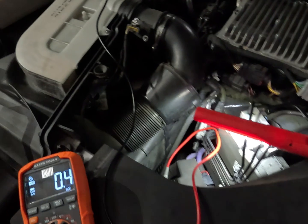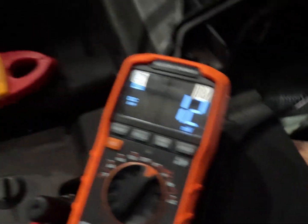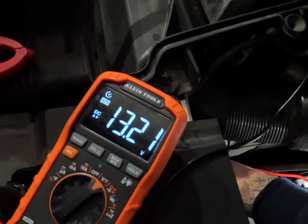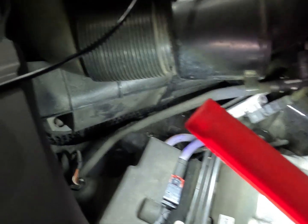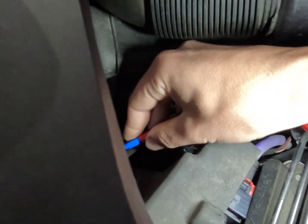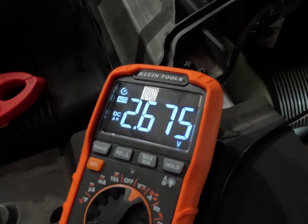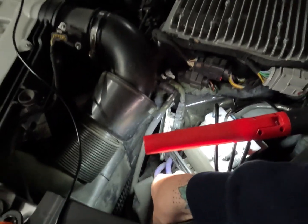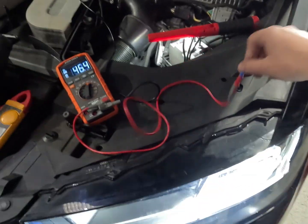We're going to go in here and check our wiring integrity. There we go - there's our 13.2 volts. Now let's get in there to our CAN wires next. That'll be our ground, so we should have a millivolt reading - perfect. This I'm assuming is a CAN wire, so 2.6 - perfect. This should be another CAN wire, 2.4 - perfect. So our communication is good, our power is good, our grounds are good, we know our high voltage inputs - our 48 volt input is good.